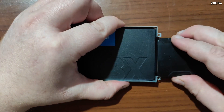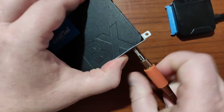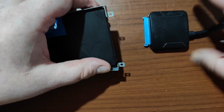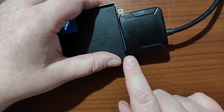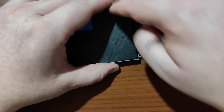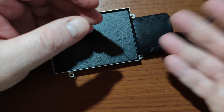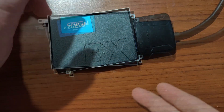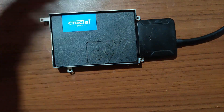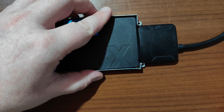I made a small mistake — the metal shroud was in the way, so I needed to unscrew one screw to correct it. Depending on the adapter design and the drive shroud, sometimes you need to remove the shroud to connect the SATA adapter, or sometimes you only have separate power and SATA cables and don't need to unscrew anything. It all depends on how everything is constructed. Now with the drive connected, I can clone the backed-up data onto this SSD.